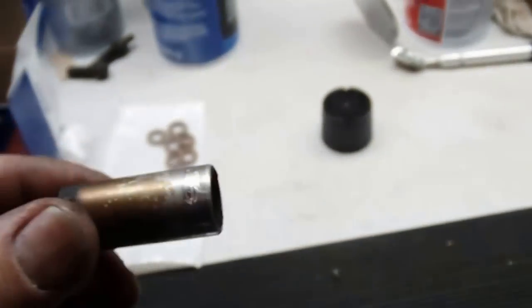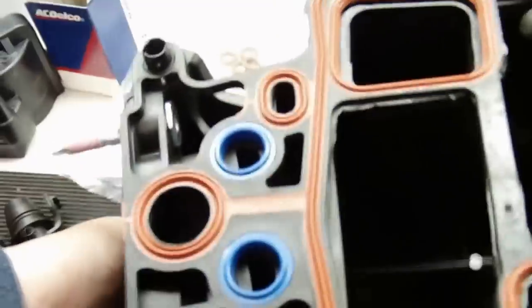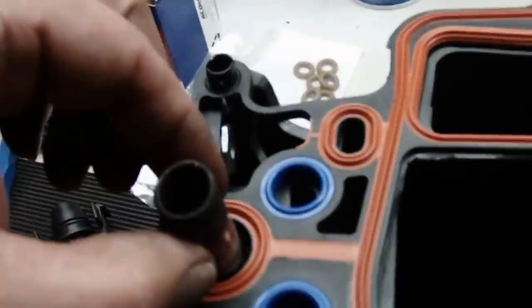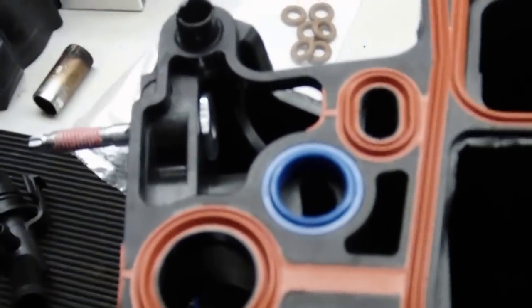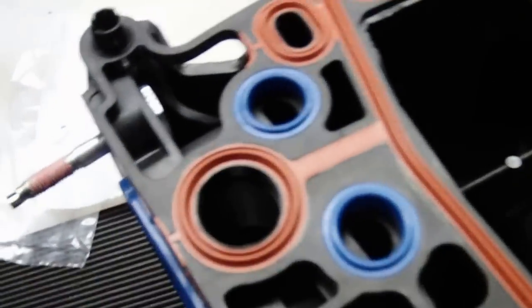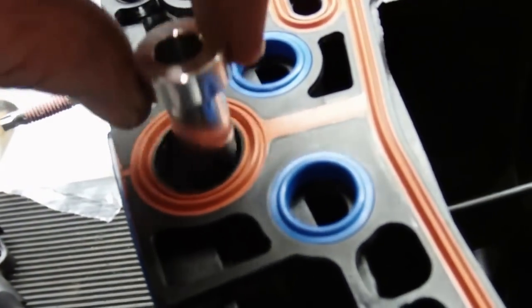And then I might have mentioned this already, but this was the old EGR port, which is actually part of causing all the problems here. With the old EGR port, you can see the diameter is fairly large. The new one, I already mounted it. Let's see if I've got the other piece to it. The kit comes with two, one for this, which is a 3.8, but as you can see, looking at the hose, the port itself, there's a lot more clearance in here, so it won't heat up.